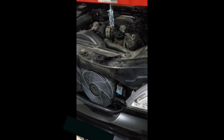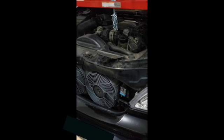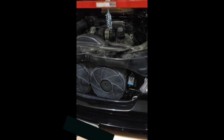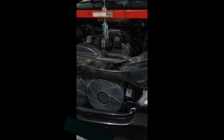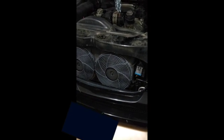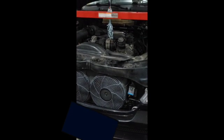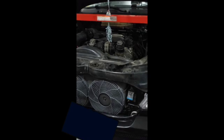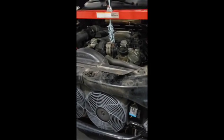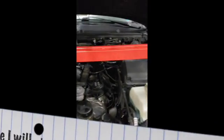Okay, I am changing the oil level sensor in a Mercedes ML350 2004. To do that, you have to drain the oil, remove the pan, and the oil sensor is inside the pan. They recommend in the instructions to remove the motor mounts and raise the engine up with one of these bars here. I'm not going to do all that.